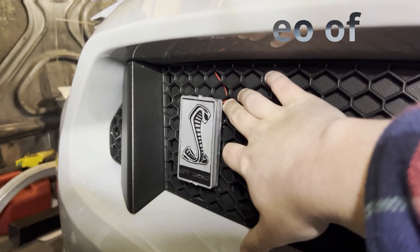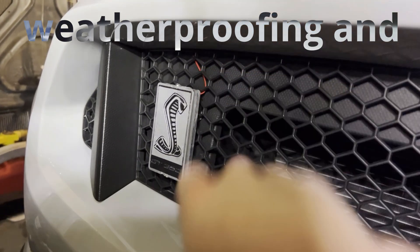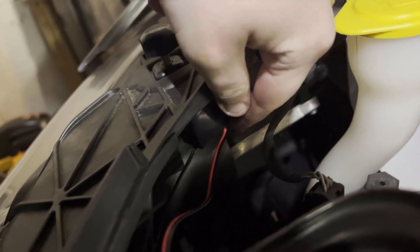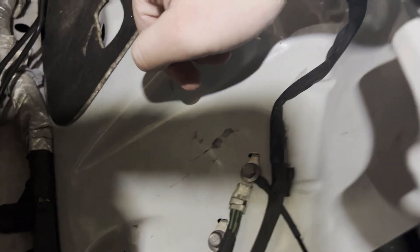Back to the wiring — I've got the wire from the EL panel coming out the back, running up through behind the honeycomb and up underneath the bumper. I'll get the inverter and power cable connector tied to the emblem power cable for hot and ground, and I'll have it tucked up underneath the radiator panel. For the ground I've got that going in where your air intake would normally be, and for the hot line I've got that into the gray with blue wire, which is your headlight wire.